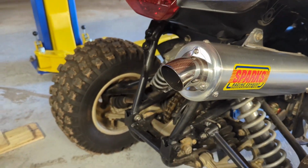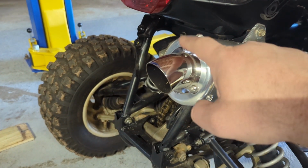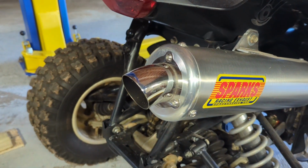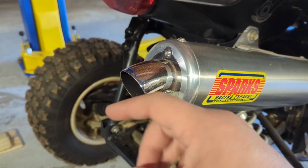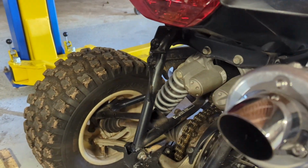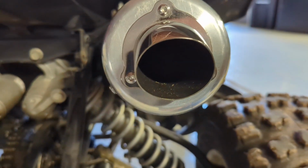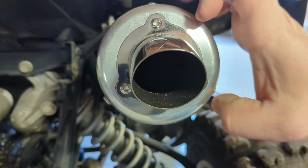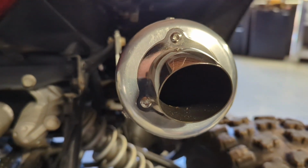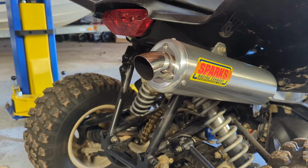That is the exhaust, and the quiet tip basically replaces this, right? You remove these right here, which are T25 bolts, so you need to use a specific little tool for that. I'll show you all that in the video. Then you remove this tip and you put another one that is a smaller diameter, so it forces some of the exhaust to stay in there instead of just going right through, because this is the same diameter as the whole pipe coming in, coming out. And this other tip is going to be a little bit smaller. So that's basically what I'm doing right now, just removing three bolts and replacing it with the one that is a little bit quieter.